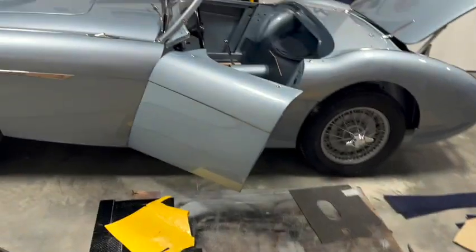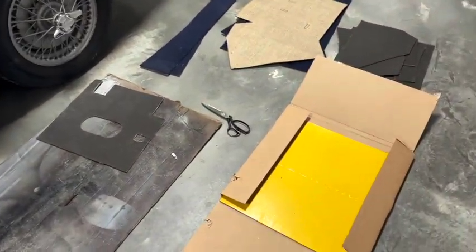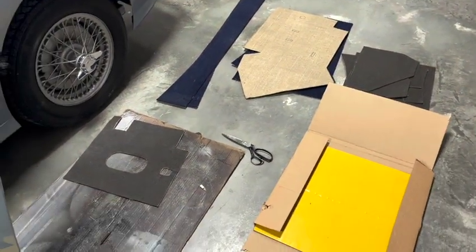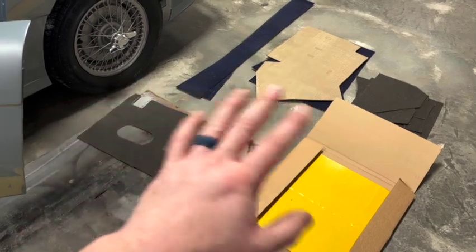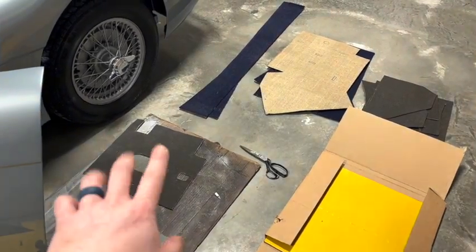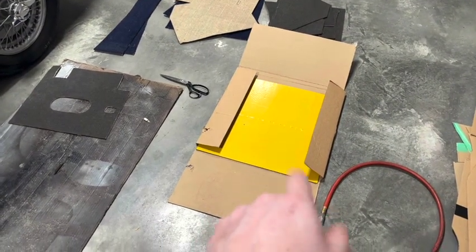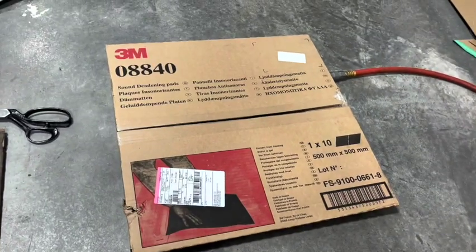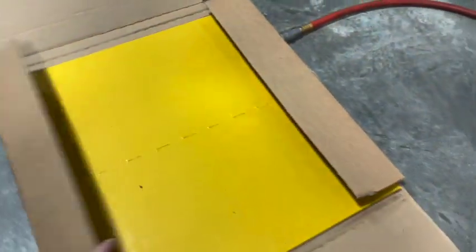For any concours judging I don't want anything non-standard noticeable, but what I'm doing is — originally they just used quarter-inch jute insulation along the firewall and tunnel sections. In the toe boards where it's all glued carpet, the carpet pieces are glued to the floor with jute sandwiched underneath against the metalwork. I'm also going to add, just along the firewall, some of this 3M peel-and-stick insulation — the 3M sound deadening pads, which do a lot for sound and heat deadening.